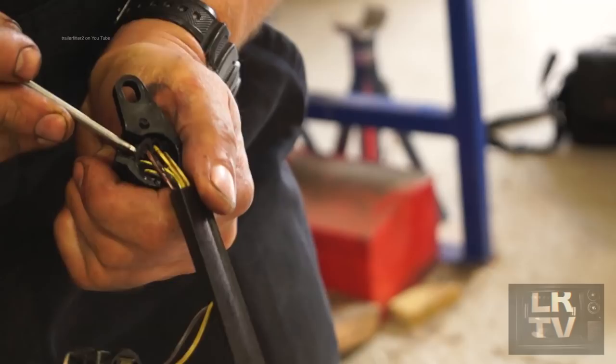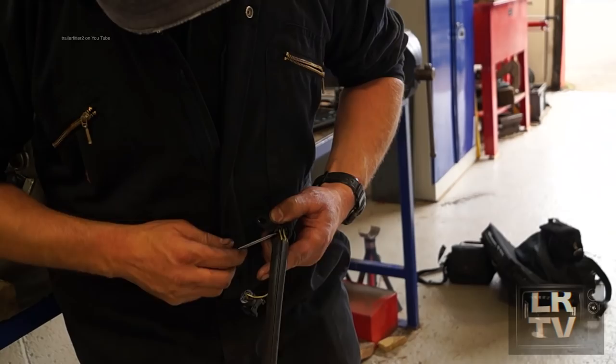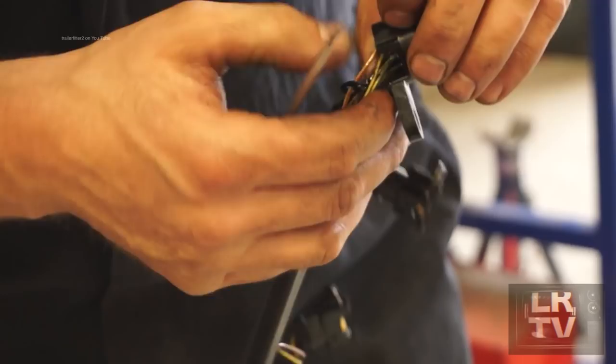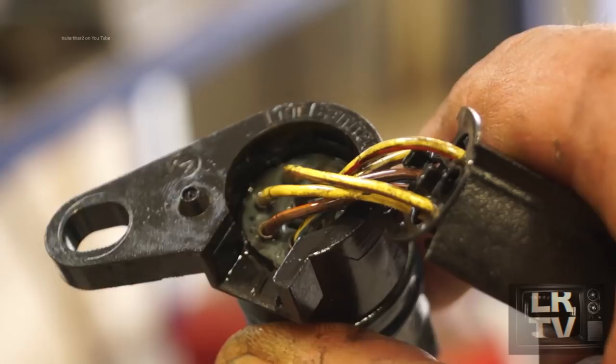Let's see, this is an old one so it doesn't matter if we kill it. Once you've pulled it, the bits are done — it's just a little plastic washer. There are certain aftermarket ones available, but genuine ones are preferred for some reason. Below there, that is the seal that does all the work. It just looks like a load of silicone snotted in there, but it is actually a moulded grommet.